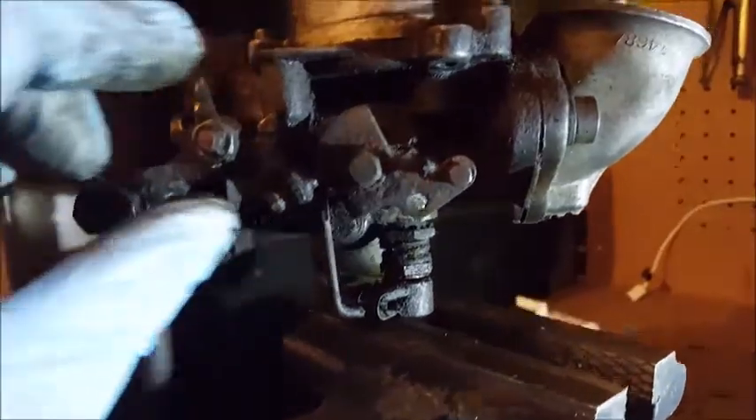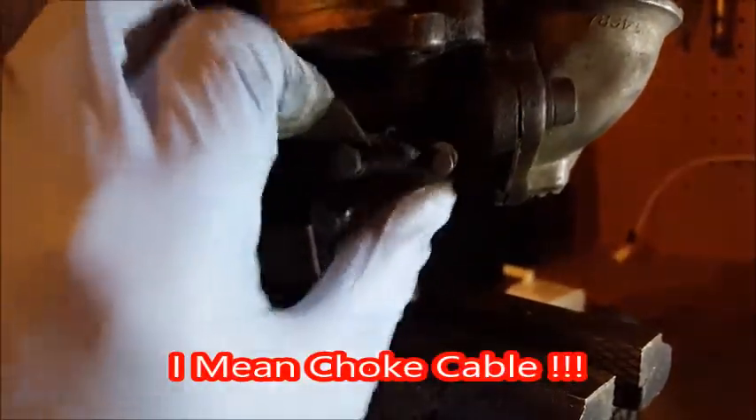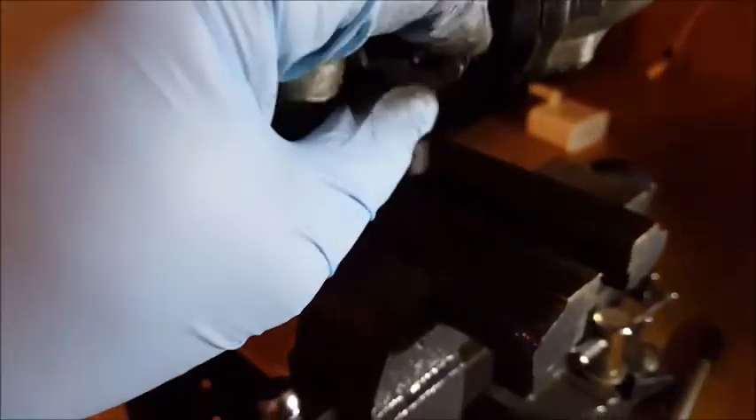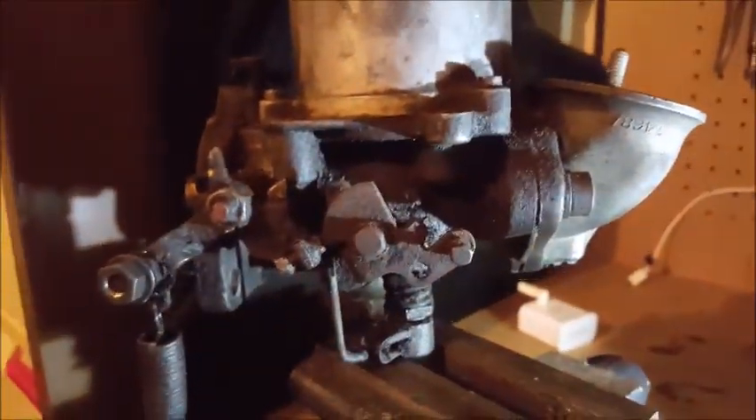I've just kept my throttle cable in place. The throttle cable — you can see the body moves up there. It comes in through this bracket, which is clogged with gunk at the moment, comes through here, through the screw which has got a hole on the other side. So I'll simply loosen this screw and it just pulls upwards, and that releases it from there.